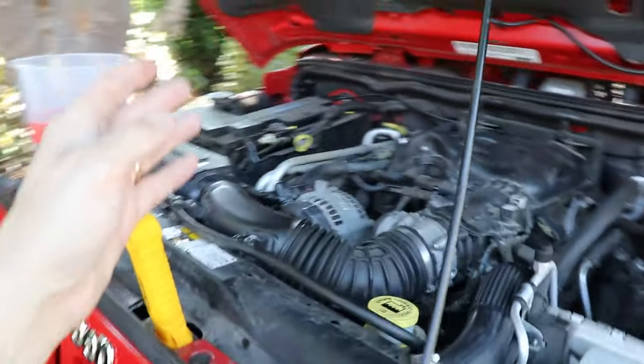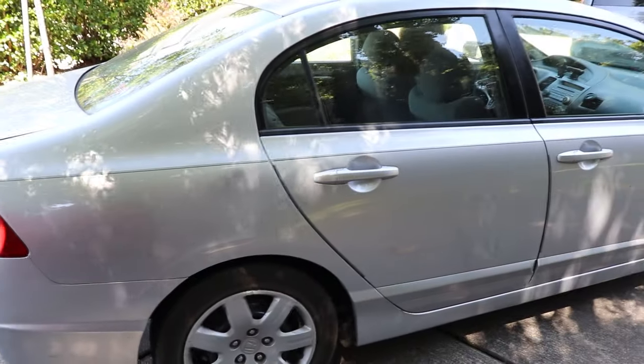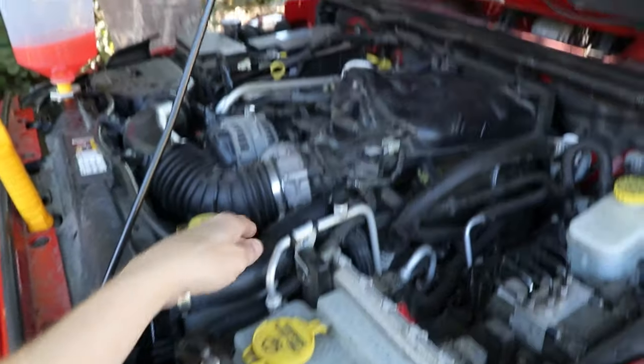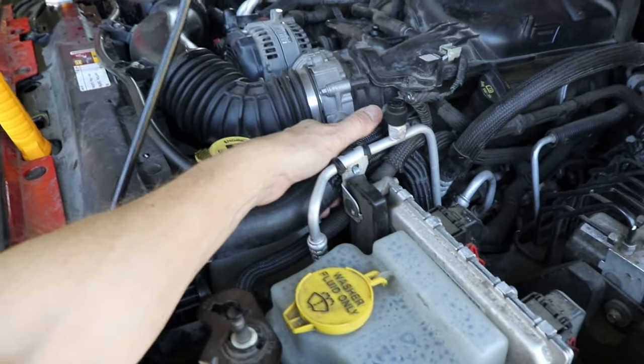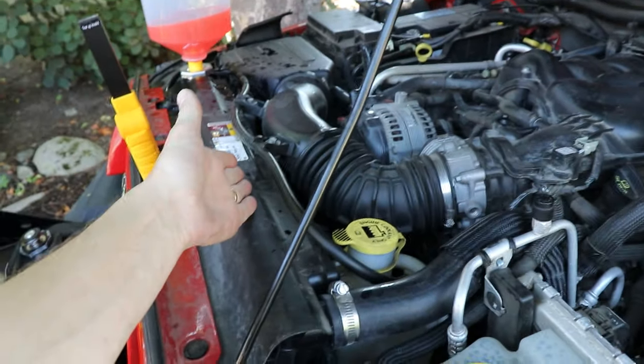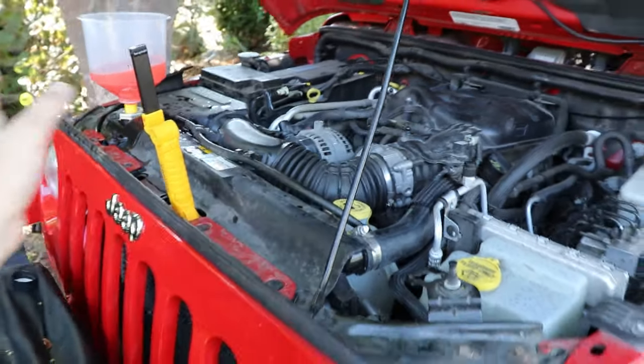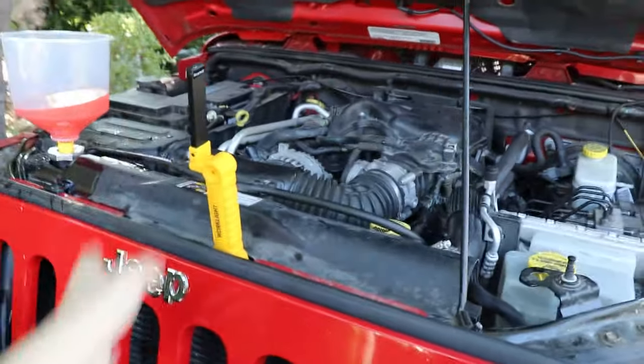The reason I really think that it's my thermostat is because this hose never got hot. Once the thermostat opens and your fluid is flowing through here, your fan kicks on. Be sure to listen to that as well. So let's replace that thermostat.